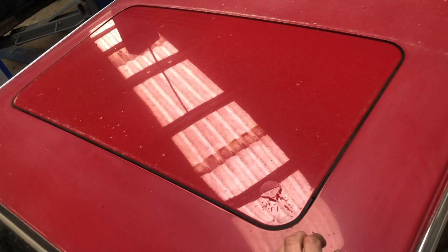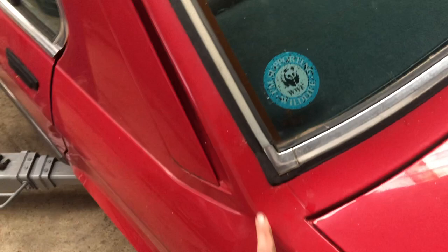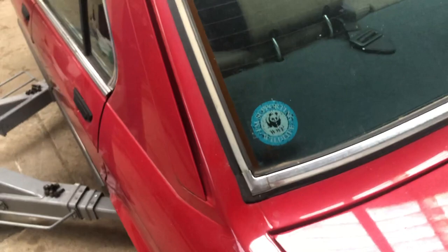Run the sunroof back and you can look at the front corners from the inside. If you pop it up you can look at them from underneath. The other place we really want to be looking for rust is in the rear screen corners — same deal, rear screen shuts, bottom corners, both sides. On this car they're really good. All this stuff can be repaired but you just want to know what you're getting into.